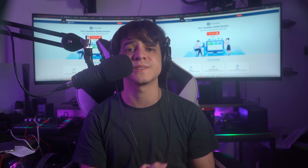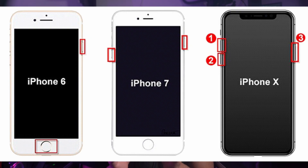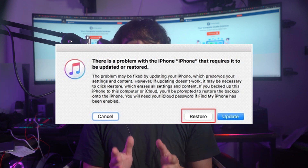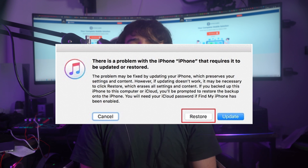For iPhone 8 and later: hold the power button and volume down until the turn-off screen appears, then swipe to turn off. For iPhone 7 and 7 Plus: use the side button to turn off. For iPhone 6s and earlier: hold the top button until the turn-off screen appears and swipe. Then put your iPhone in recovery mode — methods were described earlier. Ensure the device is connected to your computer; when iTunes detects it in recovery mode, a pop-up appears. Click Restore to recover your device, then turn it back on once the process completes.